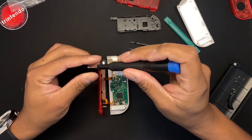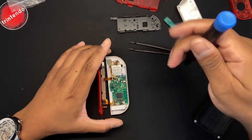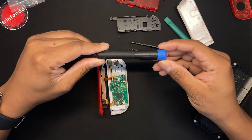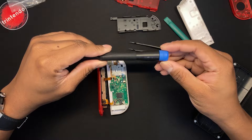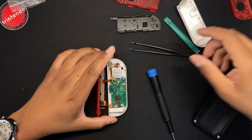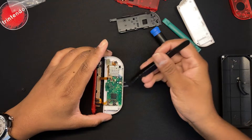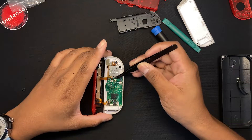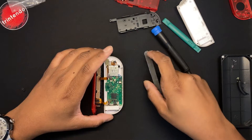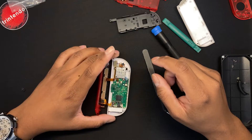That button should face up to touch the L button when it comes down on it — it will go into place automatically when you screw it in. Just a little shout out to iFixit: this is not a sponsored video, but these are the tools I use and they haven't failed me at any point. You put the cable back in for the L and minus button and clamp it down.